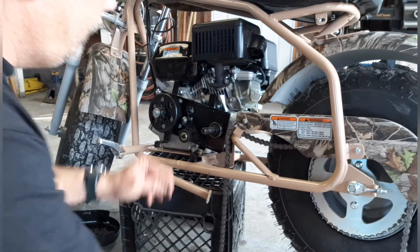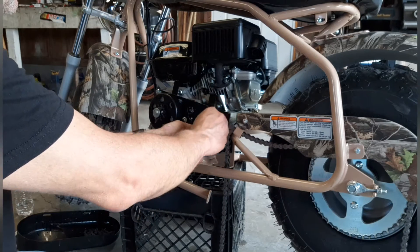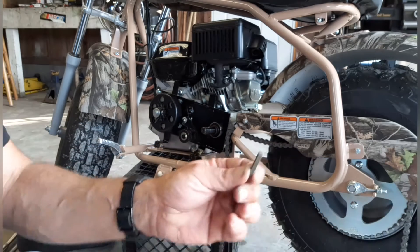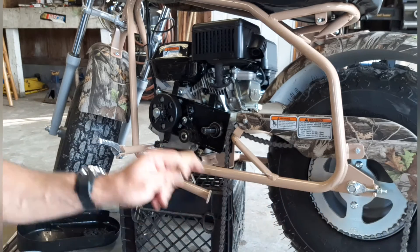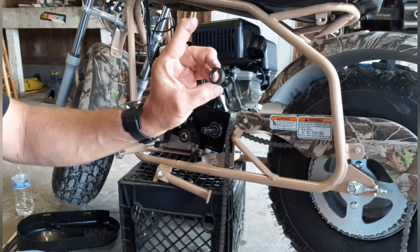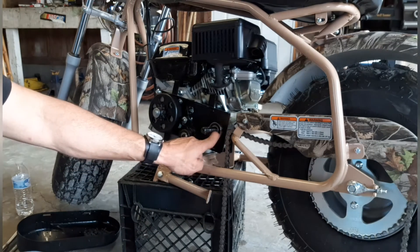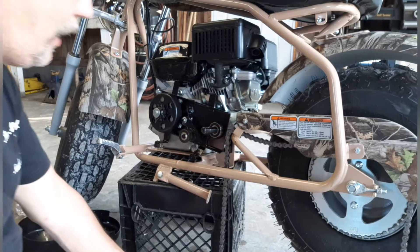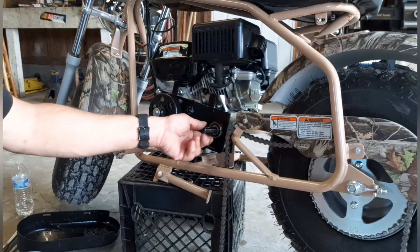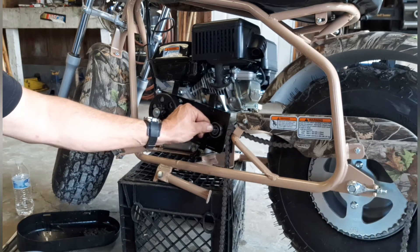Then we got this smaller gear here — lay it down right there. And there's this little keyway keeper that keeps everything lined up. It's basically just like a lawn mower key and that goes in the slot in the shaft. Then there's a little spacer. So everything's stacked up in order. In here are two bearings. After I tapped this shaft through the opposite side, it would come out the other side of the mini bike.